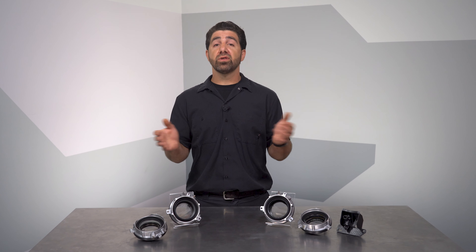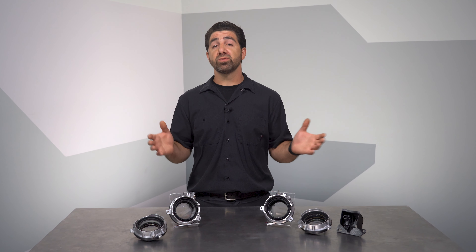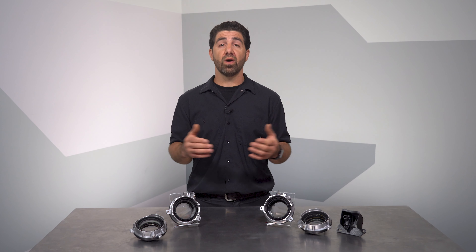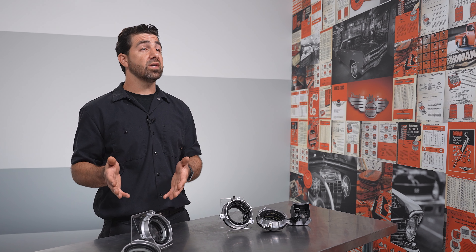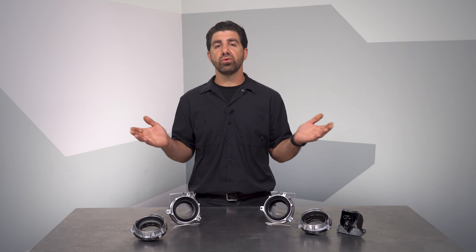Wheel ends aren't bad, though. You'll need to lift the vehicle, remove the wheel, and then the brakes. The upper ball joint can be split from the control arm, and that should provide enough access to remove the axle from the hub. From there, you'll remove the old actuator, install either your new actuator or vacuum delete kit, and then reassemble in the reverse order. It's not fast, but it's also not complex.